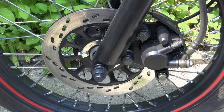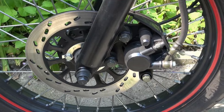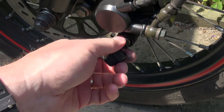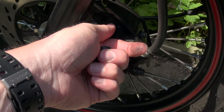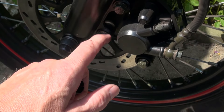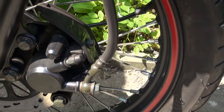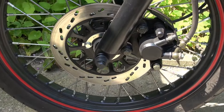A note from me in post: if you want to replace the brake pads only, there's a more convenient way. Remove this plastic cover, loosen the bolt underneath, and you can tilt the entire caliper assembly forward and pull it off its guide pin. The mounting bracket stays on the front fork and you can then easily replace the brake pads. New pads go in, slide the bracket back on, and bolt everything back up. That's the easiest way to just replace the brake pads.